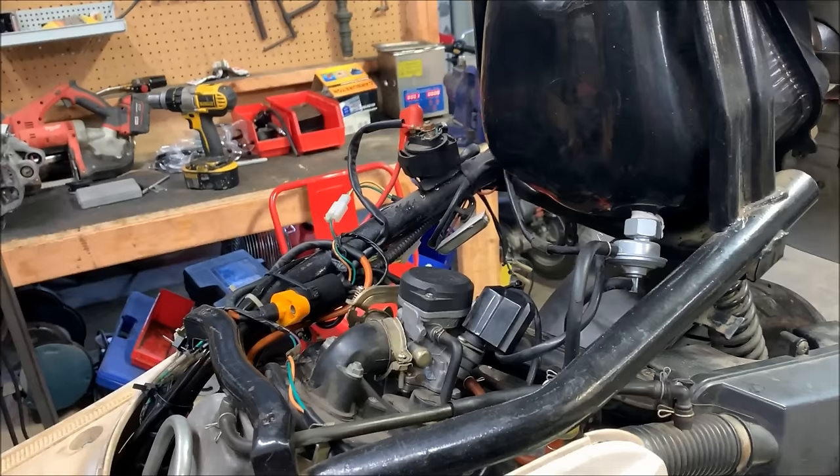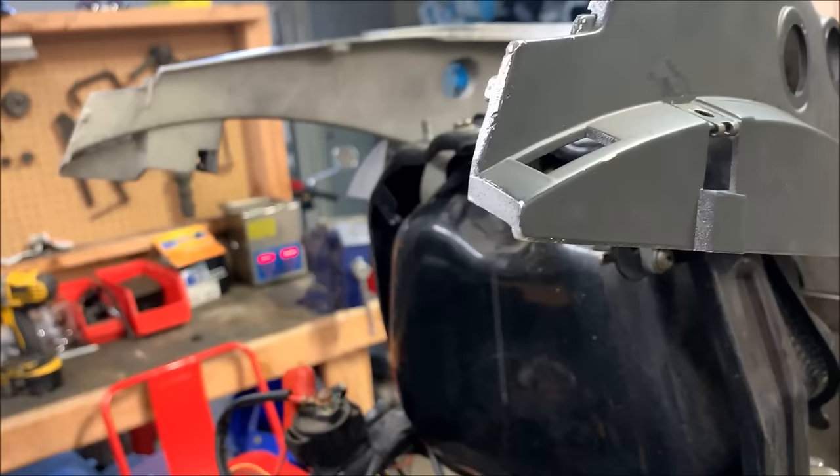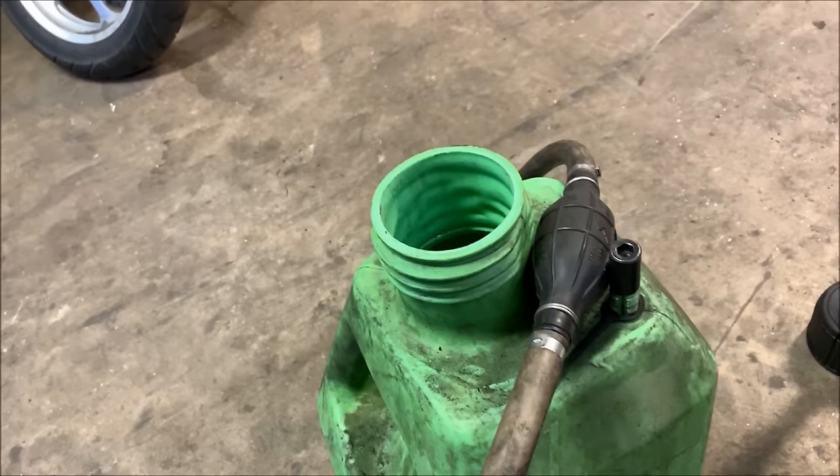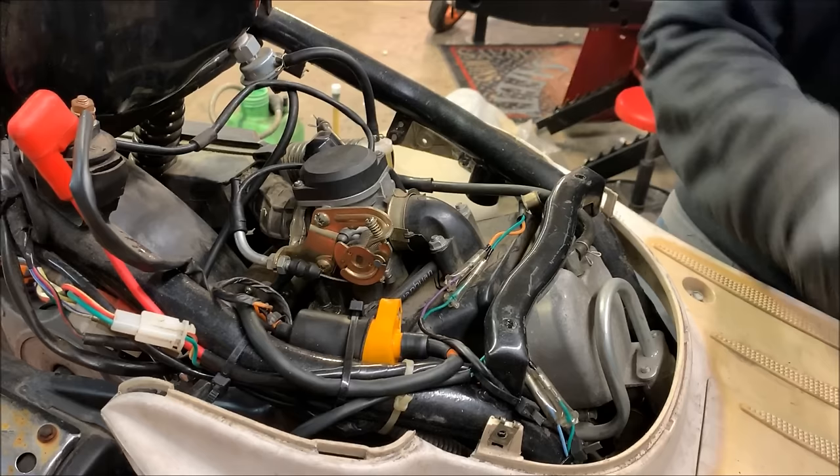The only other thing you're going to want to do if your bike sits for a pretty extended period of time — and it's always a good idea if the carb's dirty — is to get a siphon and get all the old gas out. We use a boat priming bulb; this sucks the gas right out. As long as you're downhill you can start a siphon no problem, and it'll drain a gallon tank in about 15 to 20 seconds.